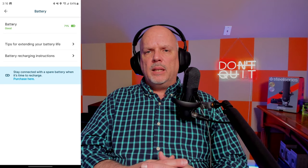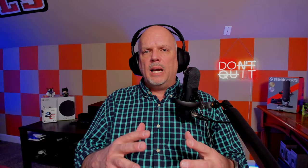Through some of the comments, I think we kind of figured out it sounds like a wireless problem. If you have a strong wireless signal, you're not going to have really bad battery life. It seems like when the signal is really weak and the device has to continually try to stay connected to Wi-Fi, it's drawing too much power and causing the battery to drain prematurely.